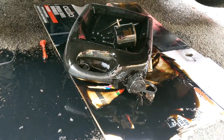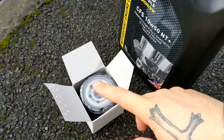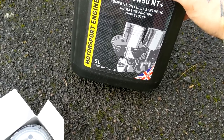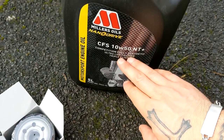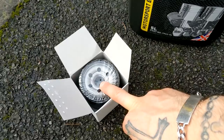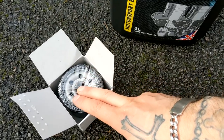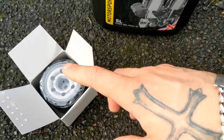Word to the wise - use a stronger screwdriver. So I'm going to chuck the oil filter on. This is the oil I'm using, it's a 10w50 - mainly because this car should have forged internals. This is what's been recommended: Miller's Nano Drive. What you do is put a little bit in the oil filter, lubricate the rim, and just hand tighten - never any more than hand tighten, otherwise you'll have to struggle to get it off like I did.